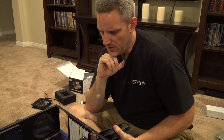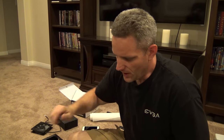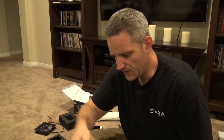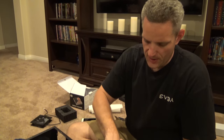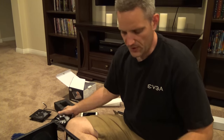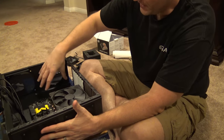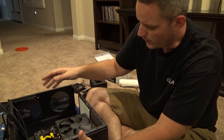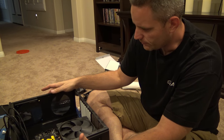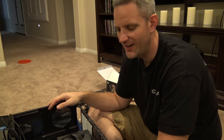That won't be that bad, but it means I'm going to have negative pressure, which is going to cause a dust issue. Maybe I'll have this one down here being exhaust and the two on the top being intake, so I've got positive pressure right here on top of the cooler. There are two 80 millimeter fans that can go right there, and I'll probably have my power supply pull air from inside here instead of outside. That way it can kind of help balance out that pressure.